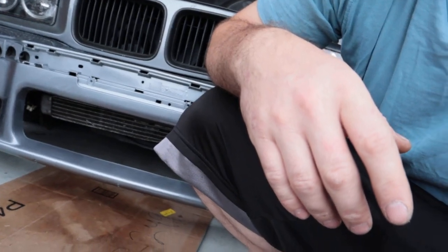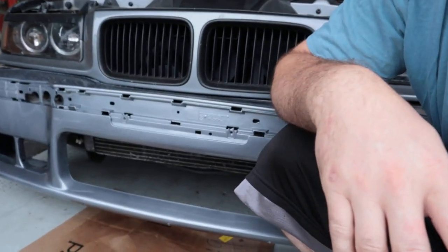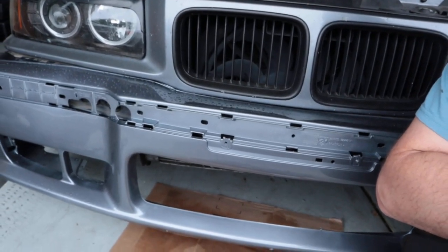The bumper — I finally got around to painting it. I'd had it sitting white for a really long time. I went to the paint shop and had them mix the paint in a can. I was using actual car clear coat, not rattle can, because rattle cans don't have UV protection and will fade in the sun. But the color came out way too bright. I knew it when I started painting but I still did the whole thing and clear coated it. I'm going to have to repaint it.